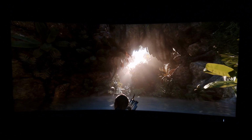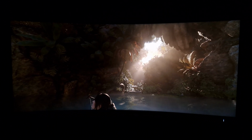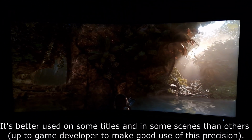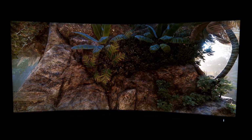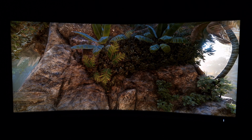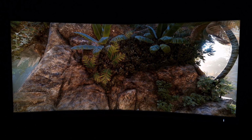and that's because under HDR the monitor is able to use 10-bit color processing rather than being stuck at 8-bit, which is really the maximum that's used for the vast majority of SDR content, certainly games. So this does give you nicer, gentler progressions of shades. It's also part of what can increase your distinction for darker shades, give you a nicer variety of closely matching dark shades. This isn't like the kind of uplift in detail you'd get with a gamma enhancement under SDR because it's achieved with a greater nuanced shade variety. It's a very different look.